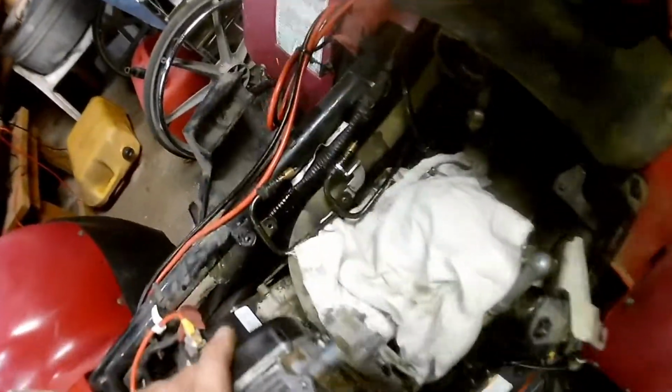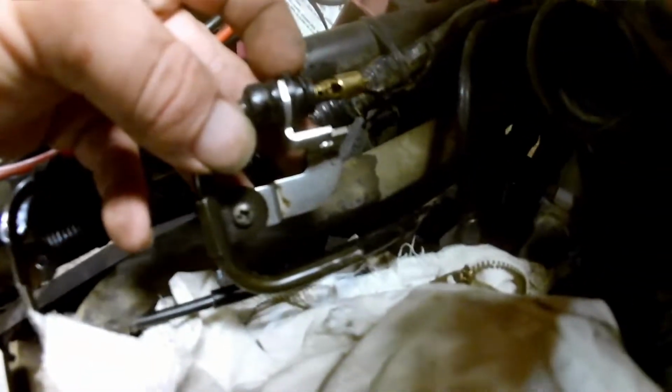Right in there and right in there. If you can just take the bottom screw out of the little bracket that holds them, right here and here, just give them a firm tug and they pop out. I was having a heck of a time trying to figure it out, but there's just an O-ring on there. And this is the bracket that retains it when it's screwed to the bottom of the carburetor and holds the bracket. So they just press in there.